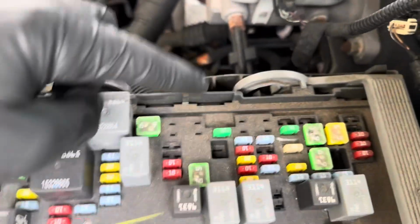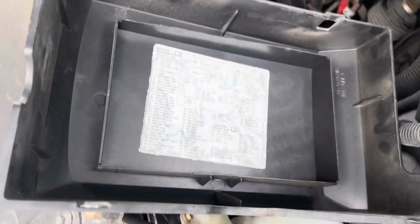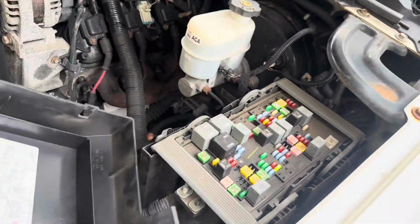O2B sensor. And then if you go down to number 18, if you have bank 1 O2 sensor issues, your truck is likely going to run a little worse than this one did. It just had the code up there. But if you look, I keep hitting this thing. Where's it at? 18 and 8. So O2B sensor, 10 amp. I come over here, figure out where that is. It just so happens to be where that 10 amp is. I pulled it out of there, and lo and behold, it is blown. So again, under hood, driver's side, pull this off, check these sensors, cross-reference, and you could find another issue.